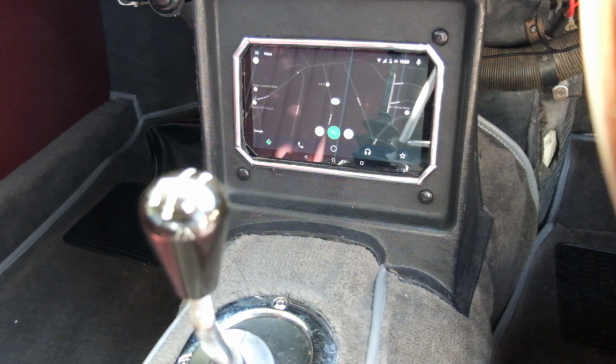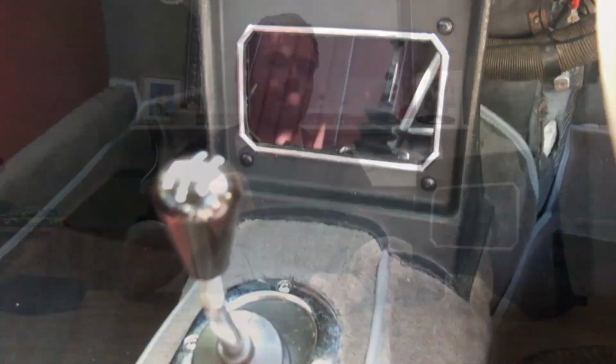And likewise, when it detects that the charge has gone from the device, so it's not charging anymore, for example if your ignition's turned off or my kill switch is down or whatever, it will then close the app and the screen will go blank, so back into standby mode. So there you're using minimal power. If you use it as a daily driver or at least a few times a week, then your tablet will just be constantly on standby, and every time you use it will charge up a bit, and then you turn it off and it'll be in standby, then it'll charge up a bit.